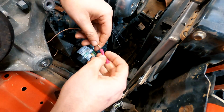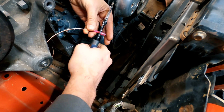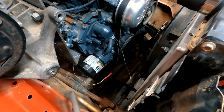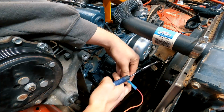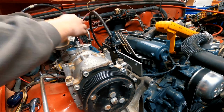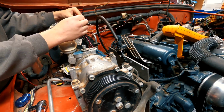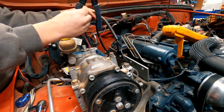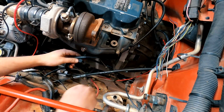Now I'm wrapping up all the wiring by connecting the wires to the wiring pigtail that's already connected to the fuel shutoff solenoid. I am using heat shrink connectors that I will shrink once I know everything works later on. I started to heat shrink the connectors, but then my lighter ran out of fuel.